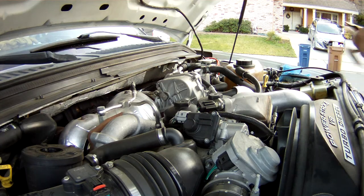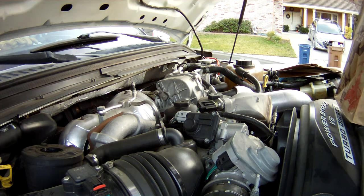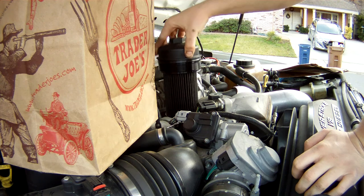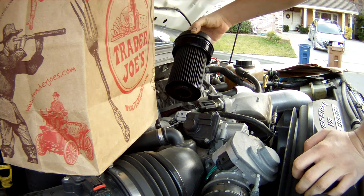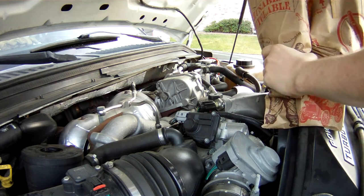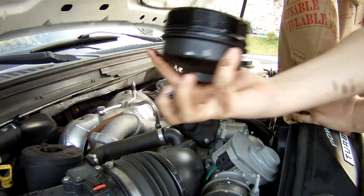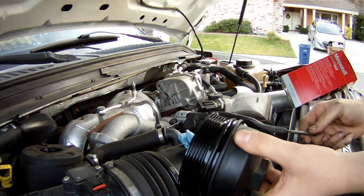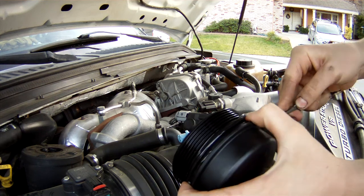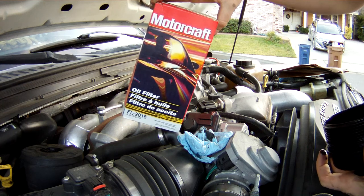While it's finishing up draining down below, I like to come up on the top side and get a paper bag to put the old oil filter in. Grab it out of there and let it drain into the bag so it's not dripping all over the place. You want your cap on its own — we're going to replace the O-ring on this as well. If you're having trouble getting it off, use a pick tool to get in there and roll it up off the seat it sits in.